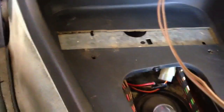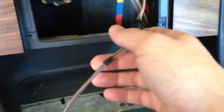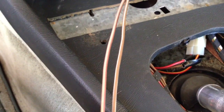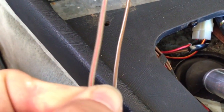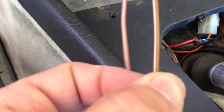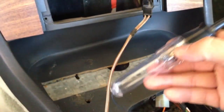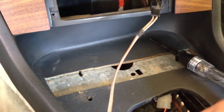Just finish removing all the screws. And there you go — see, there's wires powering that light bulb. There's this wire harness here that you can either remove or just tap into it. Right now we're going to test and see which of the wires is the positive one. More than likely it's going to be this one that I'm rotating, which is gray and red. And then the other one is a brown with white. In BMWs, mostly the brown wire is the negative wire.